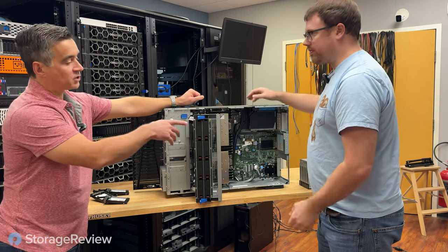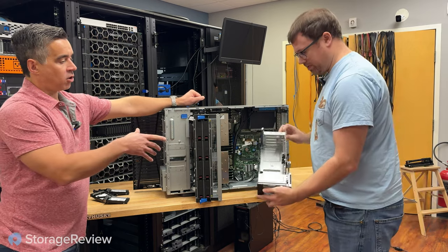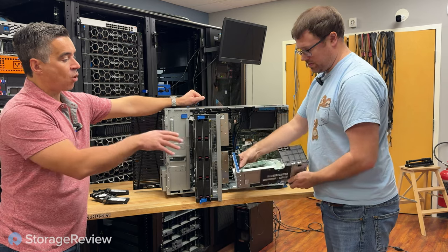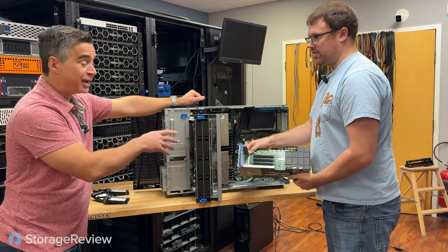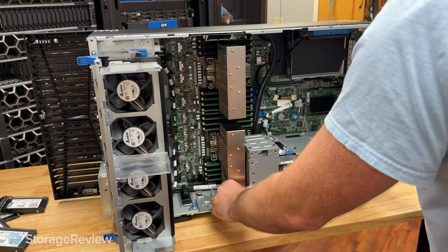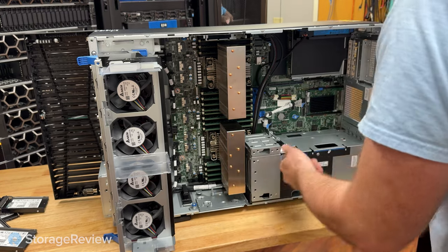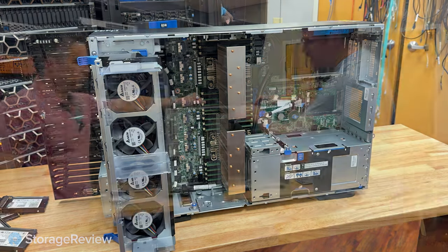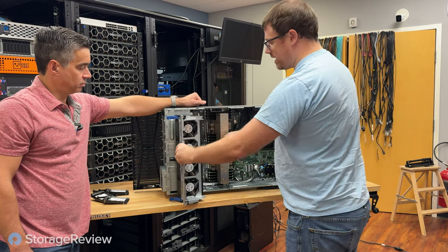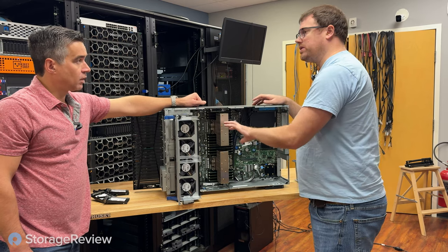That's exactly the case, because you've got a four-card expansion riser unit that comes out in one piece, which is itself kind of unique. If you want to enable the second and third riser chunks, there's another part in here — this one gives you four more slots, and then the unit tucked in underneath gives you two more. But you need the second CPU to enable all of those cards, and that also includes some of the front PCI connections and standoffs that give you more front-mounted storage options.